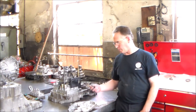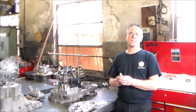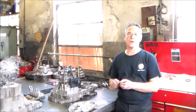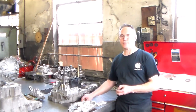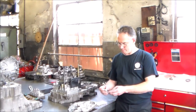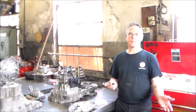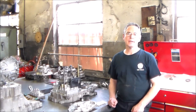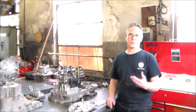What these switches do is report back to the computer that you're in second gear, third gear. They close at a certain PSI — you could have a switch that closes at 28 PSI, 38 PSI, or 40 PSI. The computer puts out a 5 or 12 volt reference, the oil comes in and creates the ground, and it takes the voltage away when it goes into third. If you have a scan tool, you can monitor the data for the third switch — it'll just go on and off, and you can know if the switch is working.